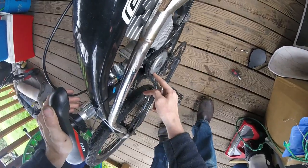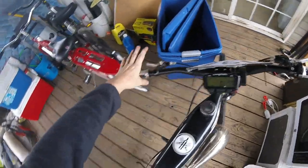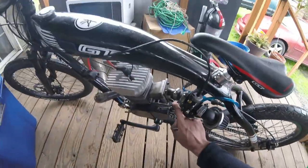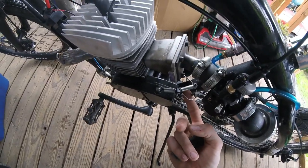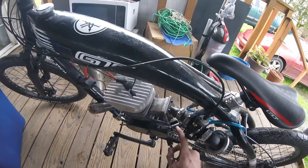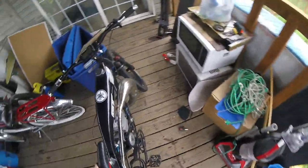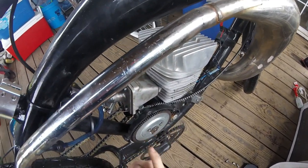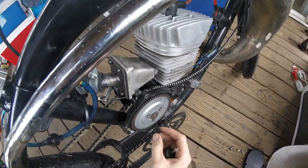When you pull your clutch in, you want your clutch pressure plate to have a little bit of play too. When your clutch isn't pulled all the way in, your arm needs to have a little bit of play as well. You want your arm to have a little bit of play and your clutch handle to have a little bit of play - this is just going to make sure that when your clutch is completely out, all your pressure is going right onto the pressure plate and into the clutch drive assembly.